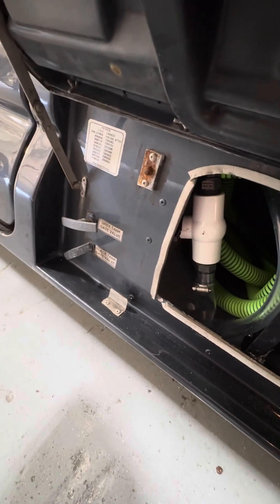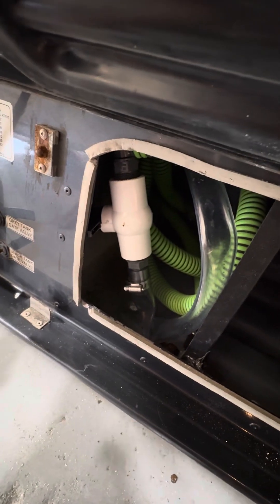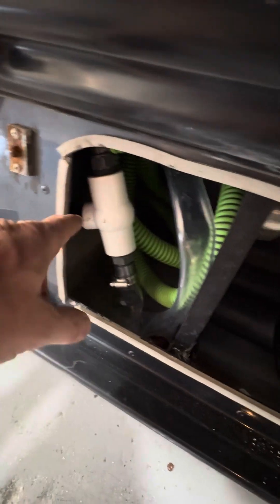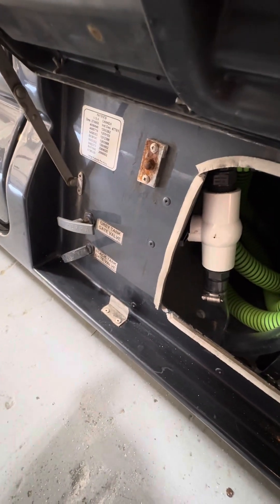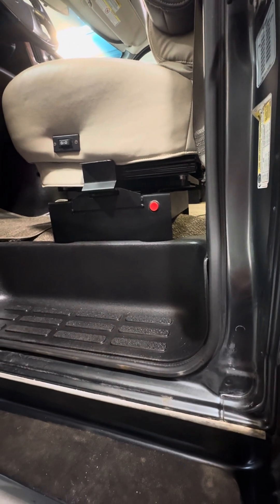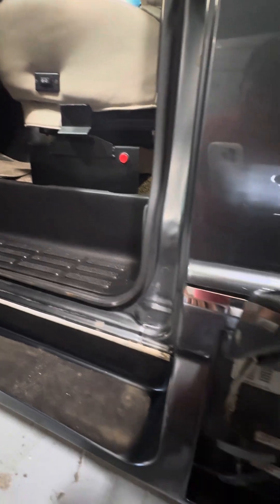Moving down to the side, there's another latch where you have your black and gray waste tank drains, and inside is the hose for your macerator. To dump a tank, take the hose, run it to wherever you're draining, and open the valve on the hose itself. Then pull whichever valve you want — typically black first, then gray. Once the black valve is pulled, open the door just inside and press the red button to power the macerator — you must hold the button down. Once the black tank is drained, push the black valve closed, pull the gray valve, and hold the red button until the gray side is emptied. Then shut the valve on the hose, coil it back up, stow it in the compartment, and close all valves.